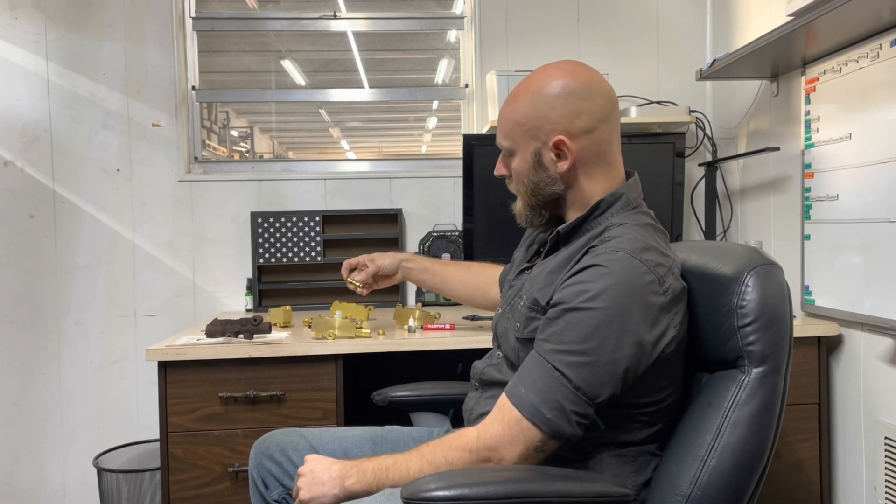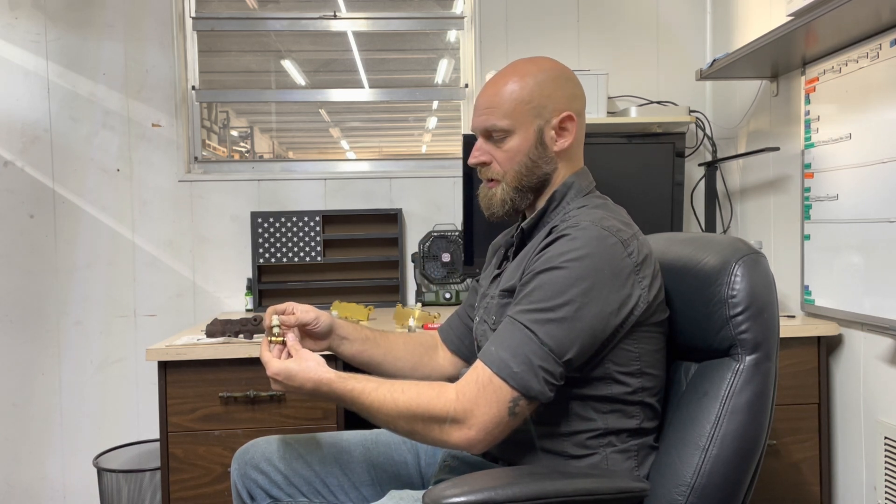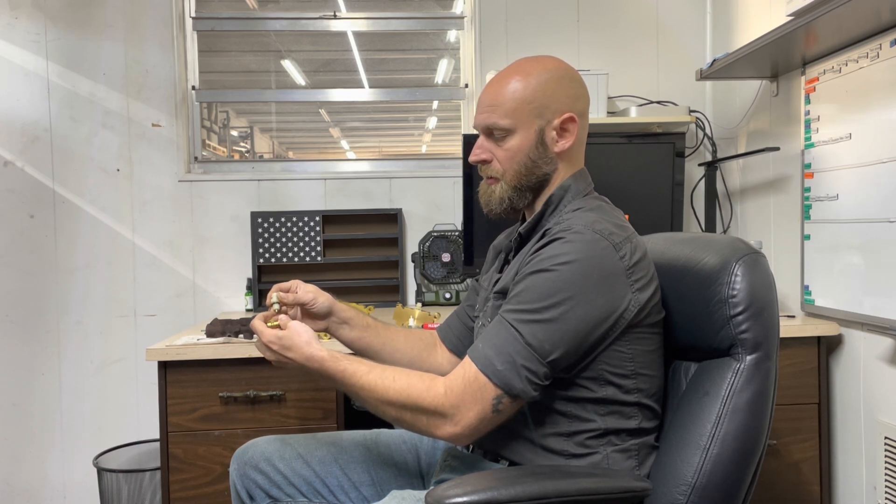Now there's a shuttle valve inside of this that can move back and forth. And there's a pressure switch that rides down into the little trough in that. If there's an air gap inside one side or the other from your brakes leaking, then what's going to happen is that shuttle is going to move to the side that has the air gap inside it, because air compresses and fluid doesn't. When it does that, it's going to send a ground signal through this to the light on your dash, which is going to light up and say 'brakes.' If that lights up, then that means that you could have a problem with your brake system and you should definitely check it out.